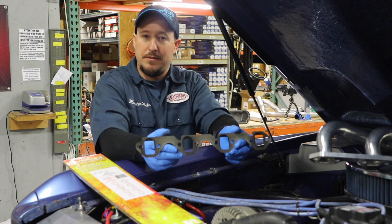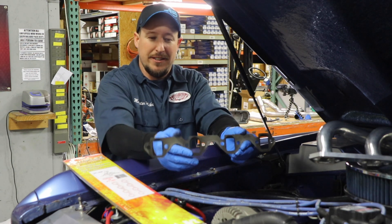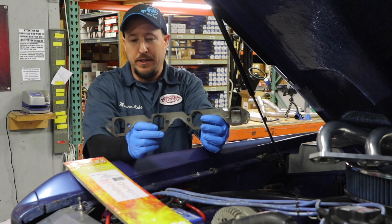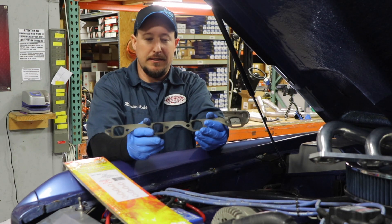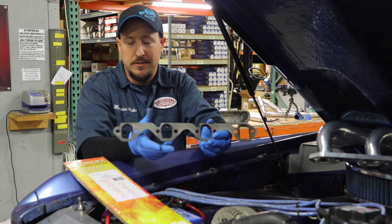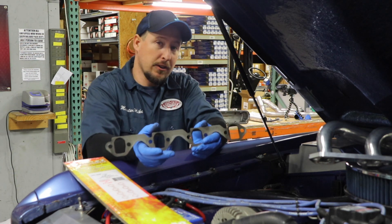So it's creating hot spots because it's adding more fresh fuel down the exhaust and basically blowing these out. We're fighting all types of sealing issues with these multi-layer steel gaskets and just could not get the headers to seal right to the heads, so we actually made a call down to Tom Hyde at Lick Creek Restorations.